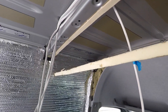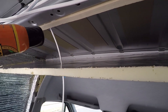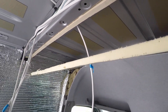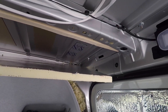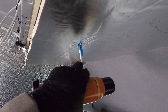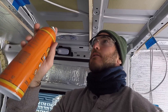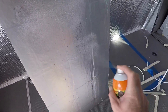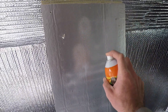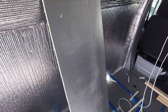Sorry I didn't get this part on camera, but I measured the foam board for this piece of the ceiling and I'm going to use Gorilla Spray Adhesive, heavy duty. I'll spray the foam board on top and push it against the ceiling — it's going to be pretty tight. I made sure it was a nice snug fit so I think the pressure alone would hold it, but I put the adhesive on just in case. Also running the wire around the puck light — I marked it with masking tape. This stuff will get in your eyes so make sure you wear glasses if you're spraying the ceiling. It goes on completely clear; you just let it sit for a minute and then you stick it on.